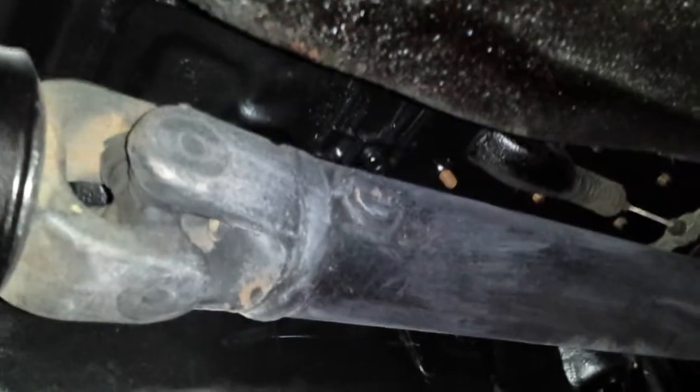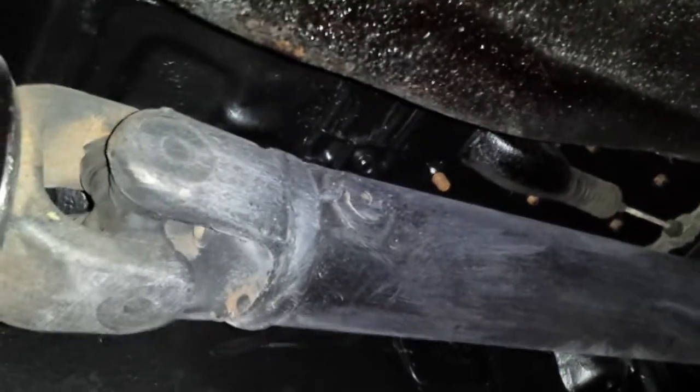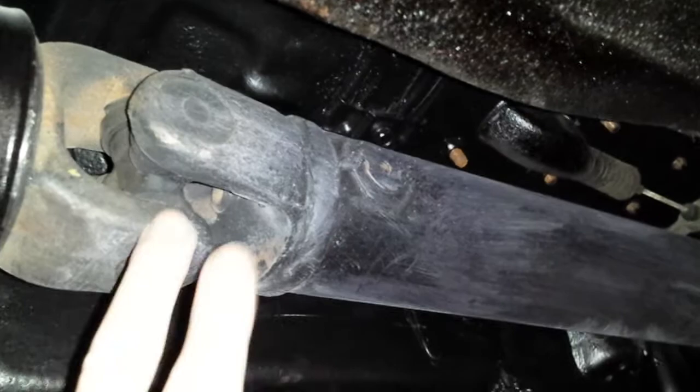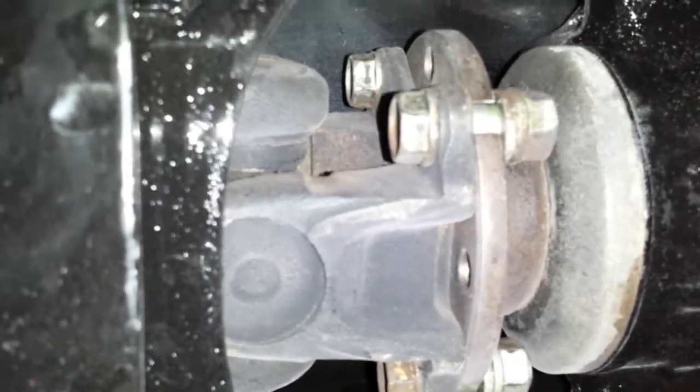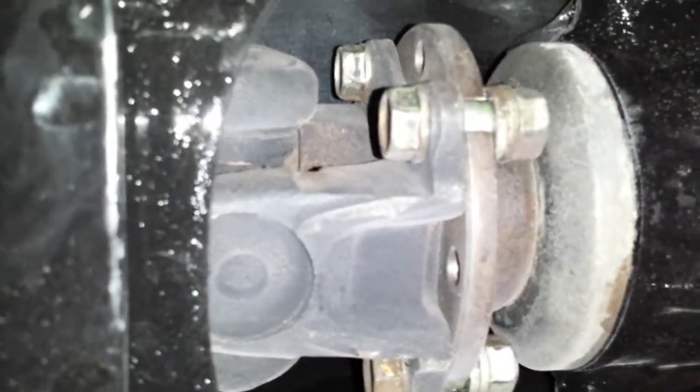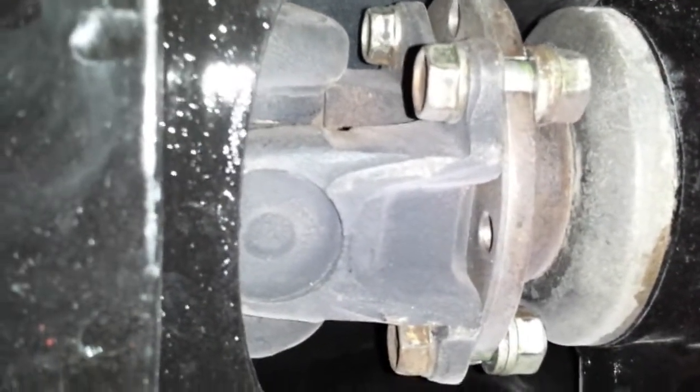Get onto the drive shaft. We couldn't find an R154 one. It's starting to get hard to find. Just the yoke is what we were looking for. But I managed to find a Mark III NA auto drive shaft at a wrecking yard, and they use the same flange on this side. So we actually took the entire thing to a shop and got them to build us one complete drive shaft, one piece. It only took them 3 tries to get it right, and they're still off by 6 millimeters, but it actually worked out okay.